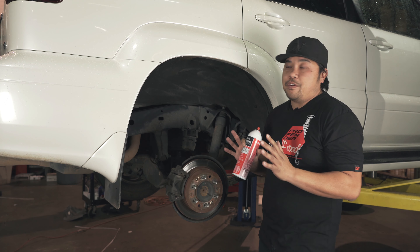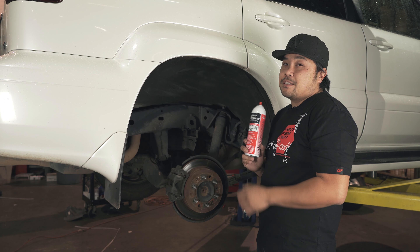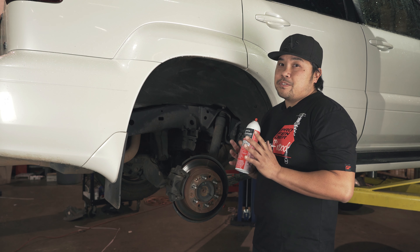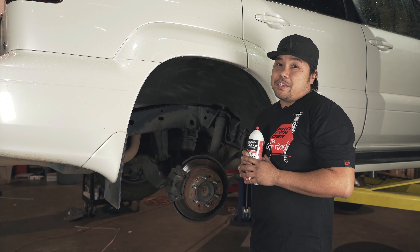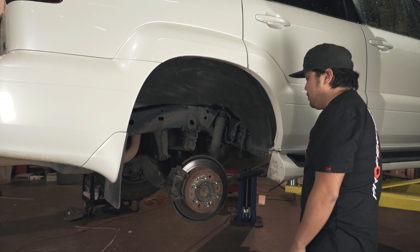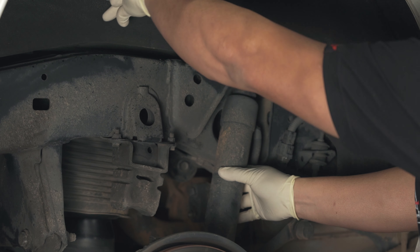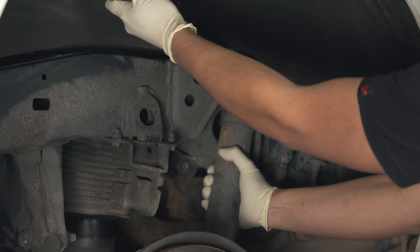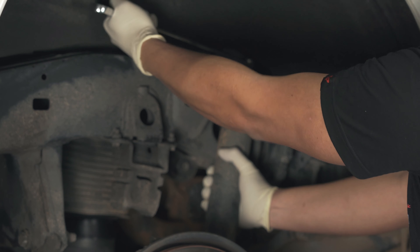So we finished cleaning off everything with the pressure washer. We're going to move on to removing the rear shock and installing the new shock. But first we need to add some penetrating oil on the nuts and bolts on the system, just to make sure the removal becomes really nice and smooth. For your east coast guys, you definitely need to let this sit overnight before you start cracking the nuts and bolts. So we already sprayed it — we're going to use a 17mm wrench and start removing the top nut. A cool trick about these stock factory Toyota shocks is you can actually grab the dust boot, hold onto the shock, and rotate the shock without the stud spinning.